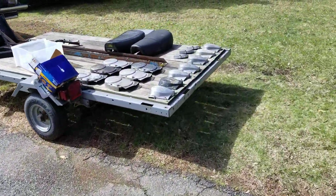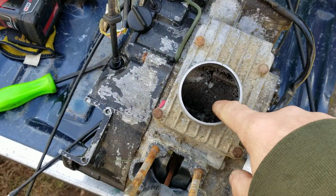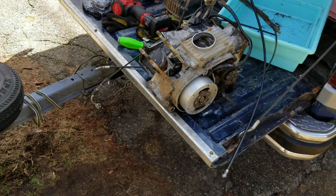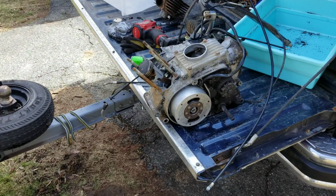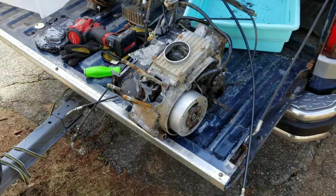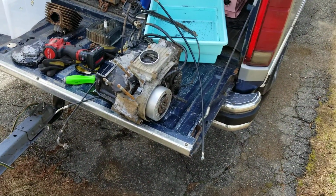And another tech tip. I know I showed you guys before about air dirt ingestion, but I want to get this stuck in your mind to make sure that your engine doesn't look like that, because that stuff right there that's inside there is going into your carburetor, and that is just bad. That's the damage it does on the intake side. And if you noticed the exhaust side has no scoring at all, which means this engine would still be on the bike running properly if they had done their maintenance and kept the intake clean, kept the carburetor clean. So it's really, this is owner-operator error, okay?